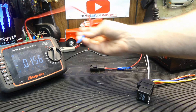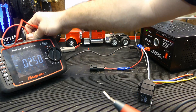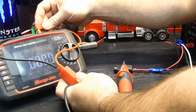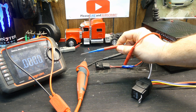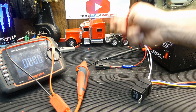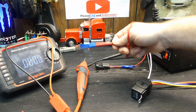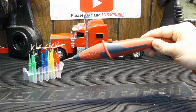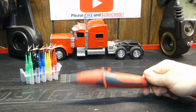Is there any other way to test this without back probes? Yes - with this. This is a Load Pro. This tool is designed to take voltage drop readings and tell you if you have an issue in a circuit without piercing the wire. I'll link a more detailed video so you can see real world applications of using it. Load Pro will tell you if you have high resistance in your circuit and you don't need to resort to stabbing anything with a needle. The temptation is just too great since they give you a nice sharp stick and lots of soft stuff you can stab - a lot of people go crazy with these. I understand not everyone is the same, and I'm just making sure the information is out there. Don't stab your insulation, and there are better methods of testing for unintended resistance in a circuit. But with a Load Pro, would you never need back probes? I wish that were the case, but it's not always true.